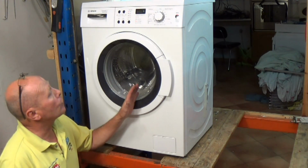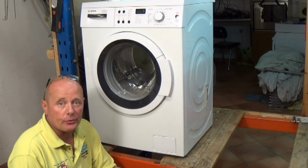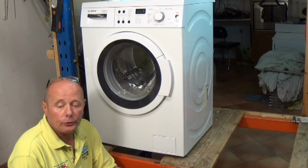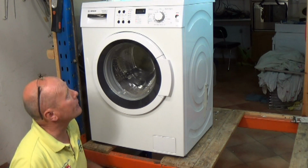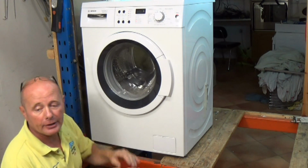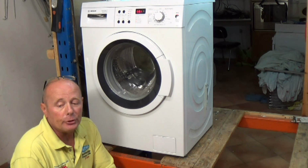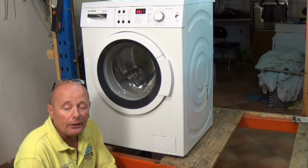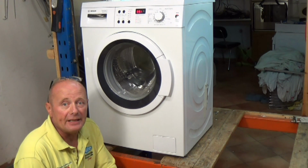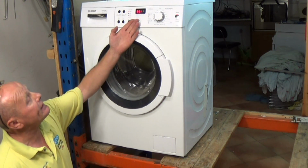This video is on a Bosch washing machine with a door interlock problem. It can also be used for Neff and Siemens makes, Constructa, Gaggenau and Schulthess, and some Smeg machines. Now E61 on this machine, this is a WAQ series, but if you have any of the WAA, WAE, WFF, WFL, WFP, WOK or WOL, you may have an error code coming up which could be F01, F03, F08, either F16 or E16, F34 or E34, and of course the E61 fault.